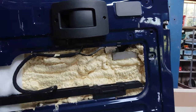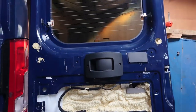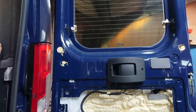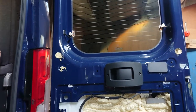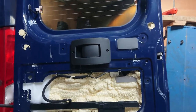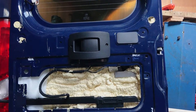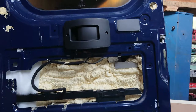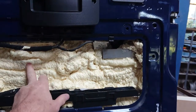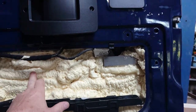I did it myself, it seems okay. I think there's so much air movement in a van when you're travelling, and when you're parked up there's so much ventilation that I don't think condensation is an issue with me using the spray insulation. This is a closed cell, so in effect it is a moisture barrier.